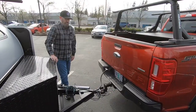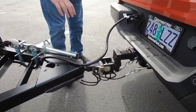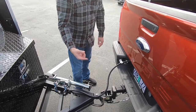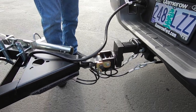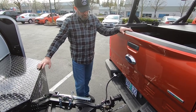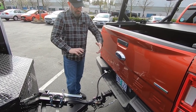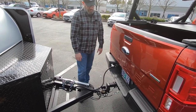Some of the advantages of the Lock and Roll over the traditional ball-style hitch is that you have full articulation: 180 degrees of horizontal rotation and 360 degrees of vertical rotation. Heaven forbid you ever roll the trailer over, it's not going to take the tow vehicle with it. Also very nice when you're in the backcountry and you're getting a lot of opposite articulation from the tow vehicle to the trailer — you've got a nice free-moving system with no binding.